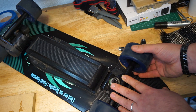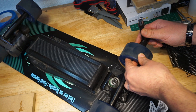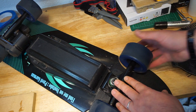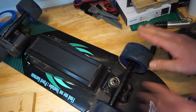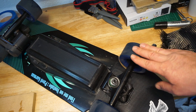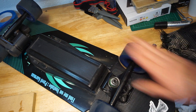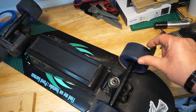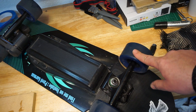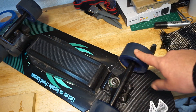You spin the wheel and it's spinning very nicely. I check for wobble — I can feel there's a slight little wobble in the bearings, so I bring the nut in just slightly, check the spin again, spins nicely, and voilà — no wobble. That's where I leave the nut. It's perfectly tight, no wobbles whatsoever and the wheel is spinning nicely. The reason I spin the wheel is to make sure I'm not forcing the bearings together too tight, because that will put them under pressure and they'll wear out much faster. But this is only for non-driven wheels.